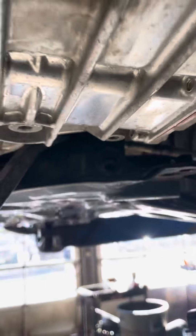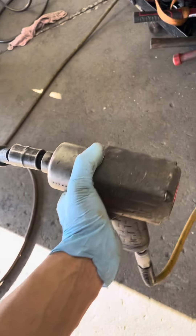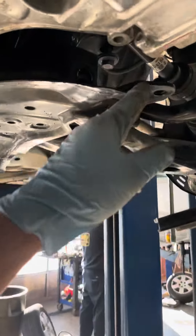At that point I just grabbed a 24mm socket, put it on a wobble and half-inch drive, and it came straight out. So I took that bolt out and the lower control arm will come straight out. Hope this helped you — please like and leave a comment.